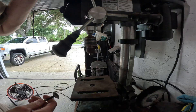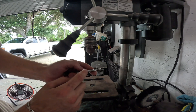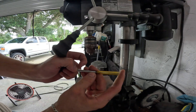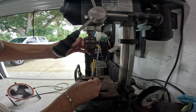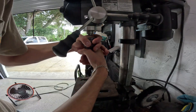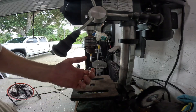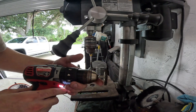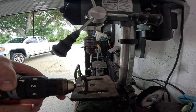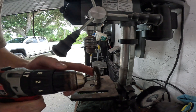So we're at the drill press — yes, it is a lot easier if you have a drill press. You don't want to put the valve straight on the chuck. You want to protect the surface as much as you can. What I do is use a rubber tube or anything that slides just snug right over the valve stem, and then I put it in the chuck. You don't have to go super tight. Now if the valve has a lot of carbon, I recommend using a wire brush and a drill. Don't use an insane super hard wire brush — something soft. And be very careful, don't push too hard.